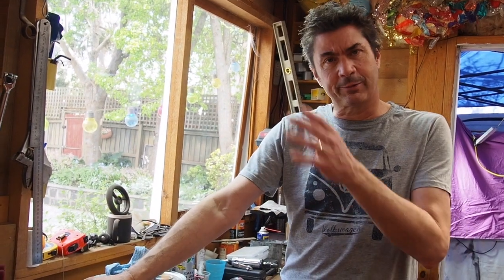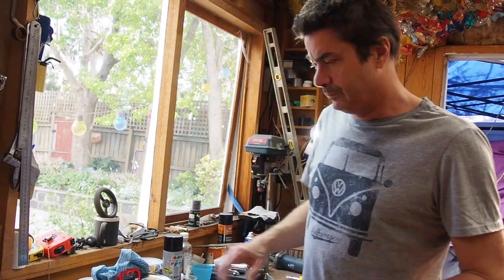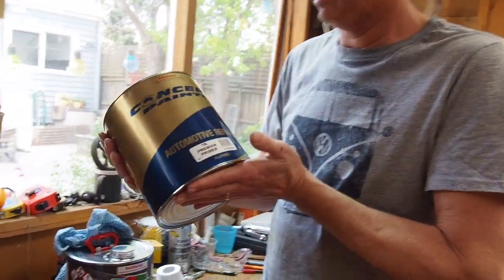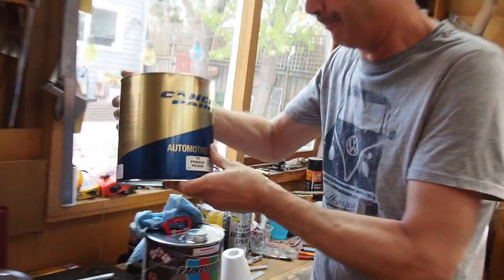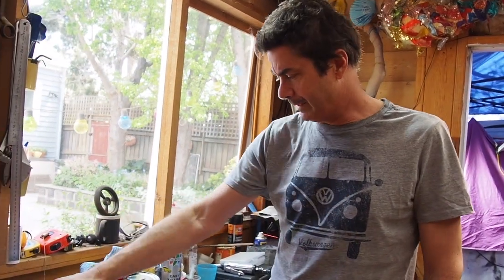What they're suggesting is that for the actual full paint of the combi, I should use a slightly different primer. The etch primer can still be used on bare metal, but once the bare metal is all sealed up, I should use this primer instead - it's Concept Paints 1K Premier Primer, which has a bit more body to it so it can be sanded off better.